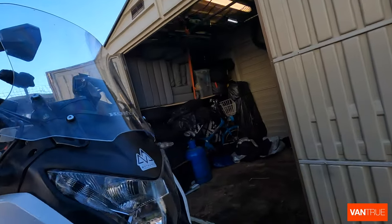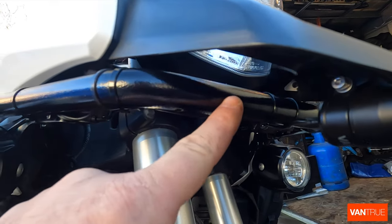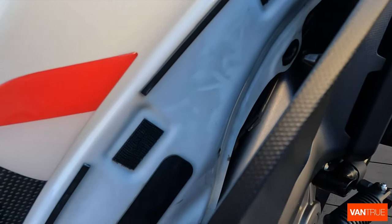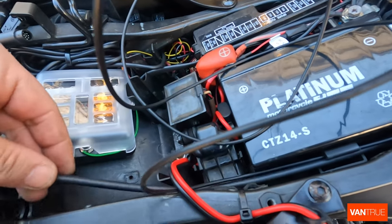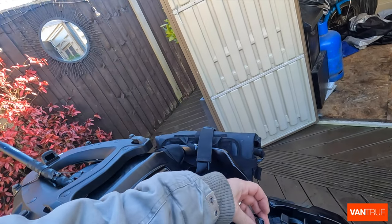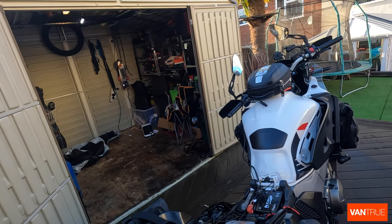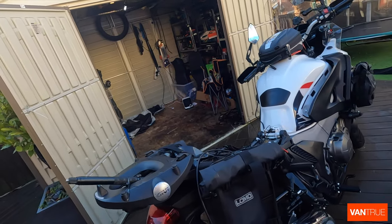There's the front camera. I've got the cable cable-tied here so if it ever did come off it would just swing. The cable runs up inside there, same with the controller cable which runs down here — they all run inside here just behind the tank, coming out down behind the battery and running up there. So the wiring part isn't that hard because all the connectors are unique. The hardest thing with the install is probably just stripping your bike, but that all depends on what style of bike you've got. So now I'm going to cable tie everything up, plug it in, get the seat on, and we'll see if it works.